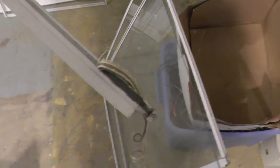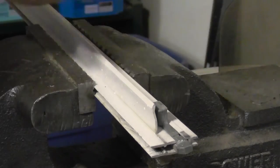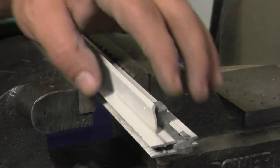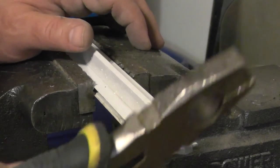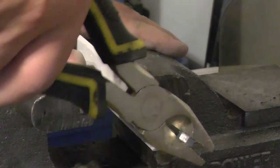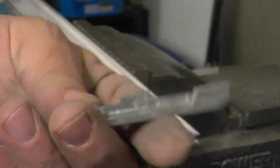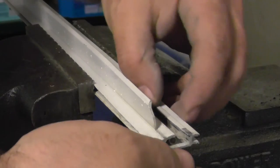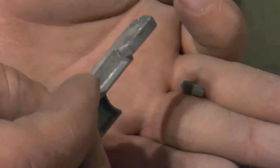This is that part of the window that's got the little latch that holds it in. To get that out I put it in my vise, not pinching this part here because you want to pry that out. I take my pliers and just give it a little wiggle, and there we go - now that's out. That's another piece of cast aluminum. Holding that in is just a spring and a little piece off this part.